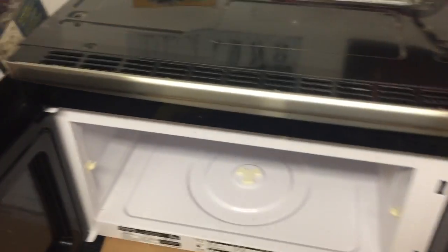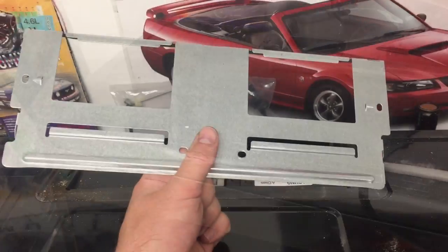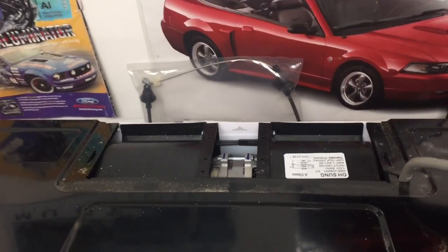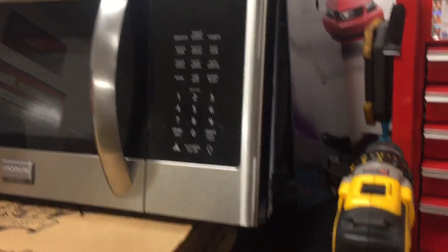I did have to pinch the cover that goes around the light bulb. Next we're taking out the screws here at the top that are holding the vent in. Basically everywhere you can find screws on the case, go ahead and start taking these all out. There's also a little tray-type thing at the top for a heat shield — just take those screws out as well. Now we're leaning it back over to get to the back side and removing those screws.